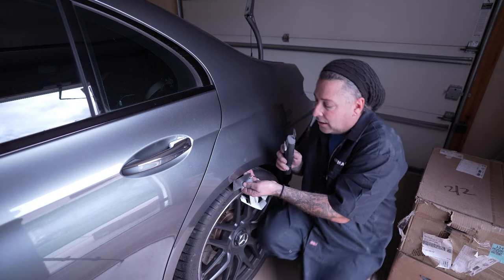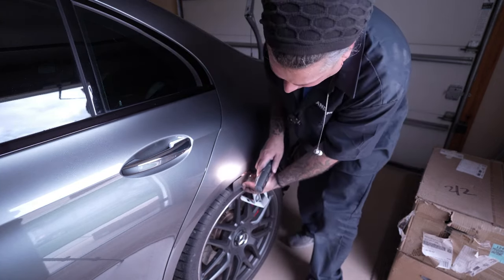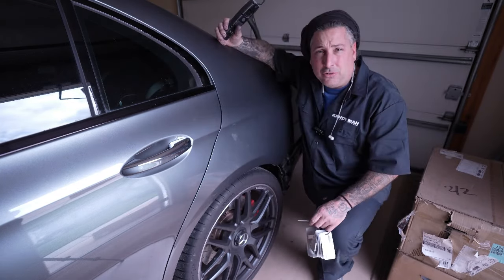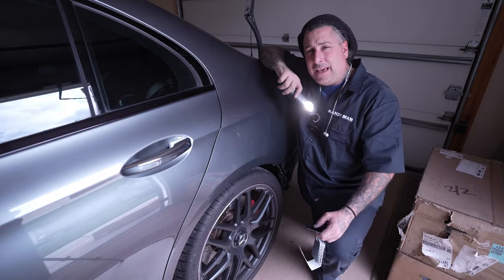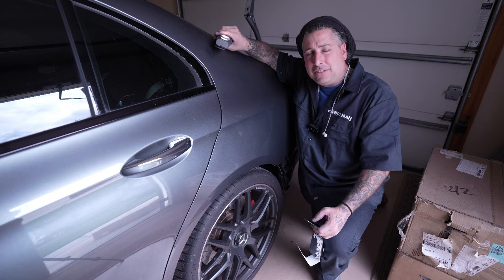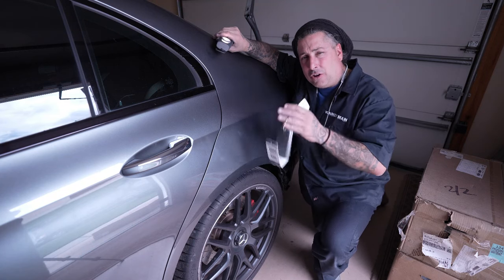So one thing that you do with the light is you put your chip up to it, and then you'll check the flop. So the flop is a different angle of the color. And sometimes you'll maybe be in traffic and you'll see somebody that has a bad blend on their car. And that usually is the flop. That's the metallics using the dark tone.